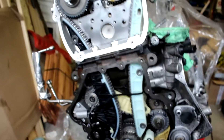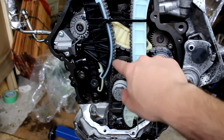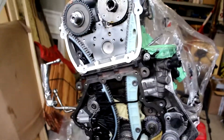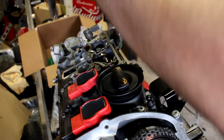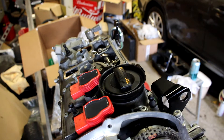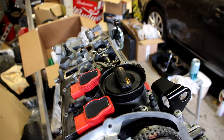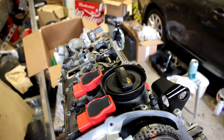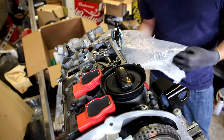I also haven't released the tension retainer pin on the oil pump chain tensioner yet, but so far so good — everything's coming together. It was really difficult to get this chain on and none of that was filmed because it's been really stressful. This is the first time I'm timing this engine, so I just want to do it right. The next thing to replace is the PCV because we're already blowing a small fortune on fixing this, may as well spend a little more.